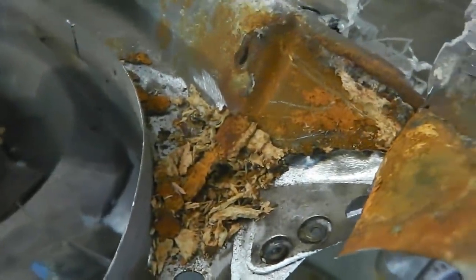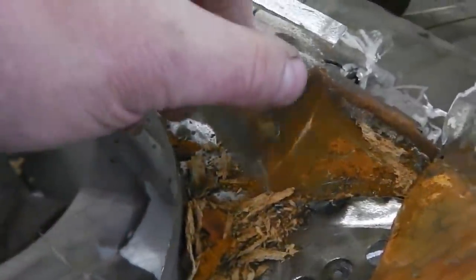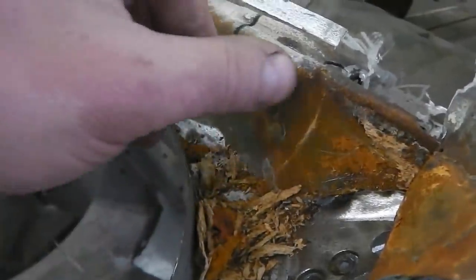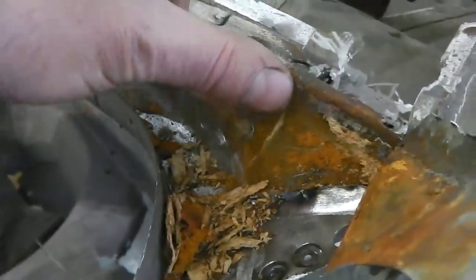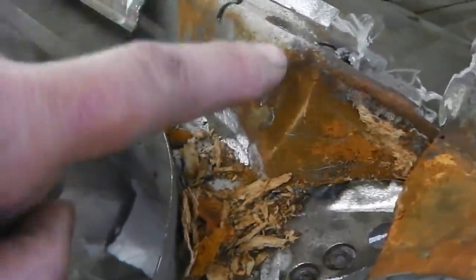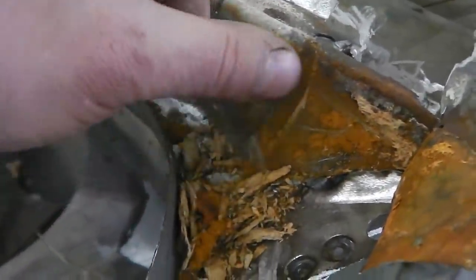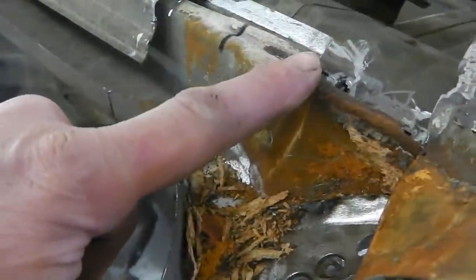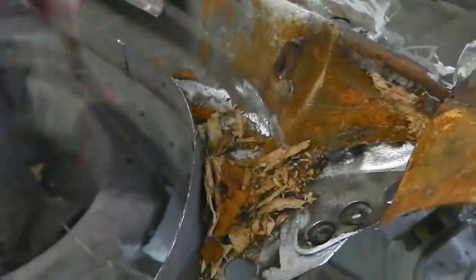You see that sealant there, and you can see again Ford's typical recess that they make when they use sealant. They tend to leave these little sealant channels, so they'll caulk that up and it'll form a cut off end there. Or indeed they could have just injected the sealant into that reservoir, that recess, and it's squidged out that way. I think they looked for these recesses and the caulk gun went in like that, and as you close that panel on top it squeezed it into this area. That's what I think happened.